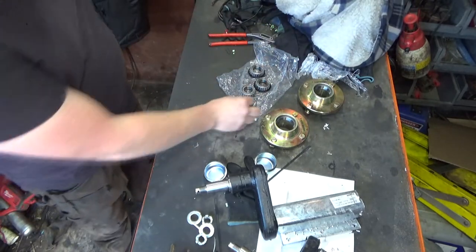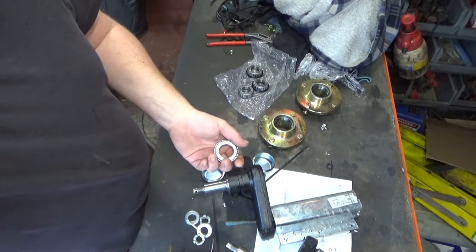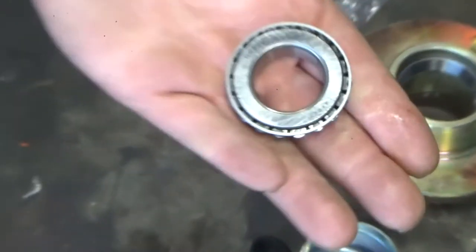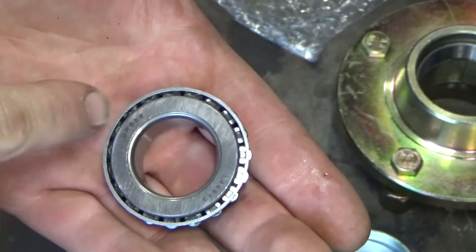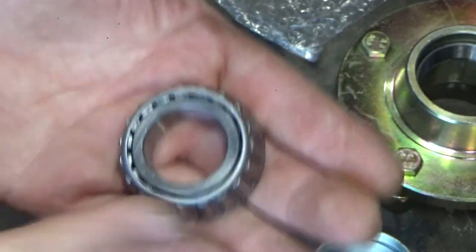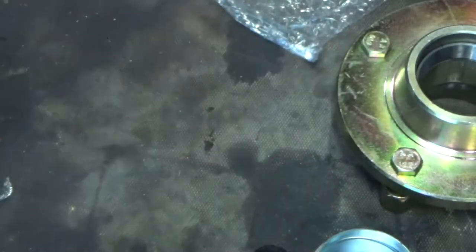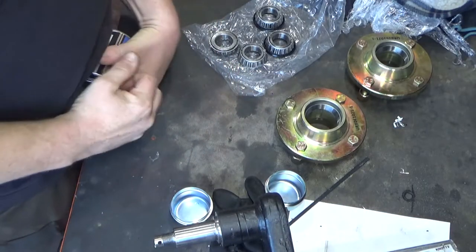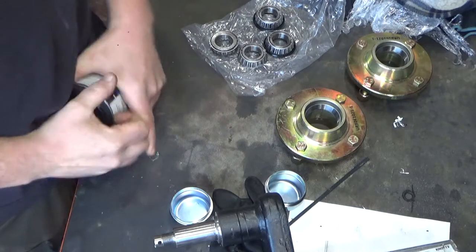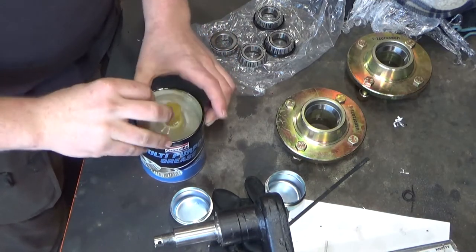Because what we need to do is pack the grease in. And where we're going to pack it in, I'll move you so I can actually see the screen. What we've actually got to do with this is get the grease inside, so it's actually inside the bearing, not smother the outside. We want to get it in that gap. It's pretty straightforward, it's easy with a grease gun, but we're going to be doing it with a pot of grease because that's what came with it and that's what I shall use. It's an impenetrable fortress of a lid. Now, if I can get this off.